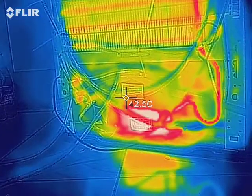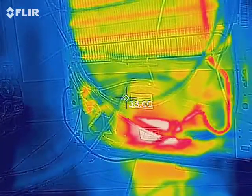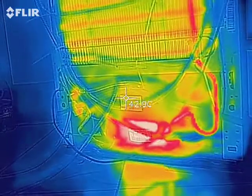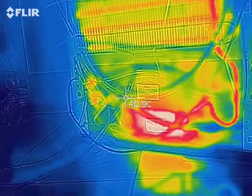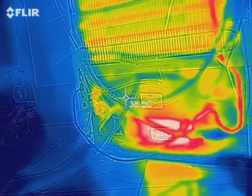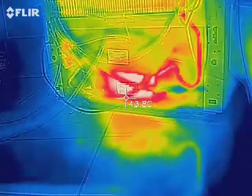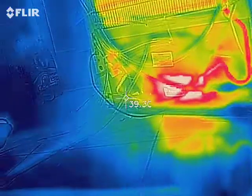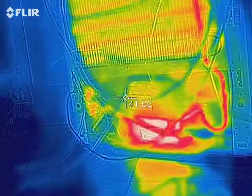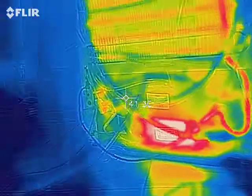This is of course not the best way to get the energy out of the fridge because I don't want to ruin my fridge — I still want it to cool my stuff and I didn't want to mess too much with it. The best way would be to make the gas expand into a heat exchanger, or to make the coil actually do the gas expansion directly into where I wanted to heat things. But the concept is sound and I'm actually being able to extract energy when the fridge is on and the water pump is on, and cool the compressor and the gas expansion coil.